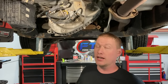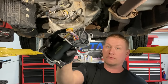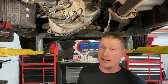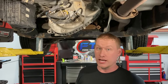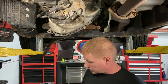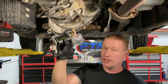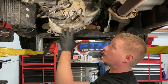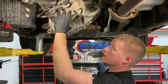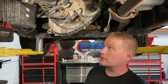It's a very common failure, but luckily it's a very quick fix. The only problem is the Ford motor, which is the one I recommend, is expensive — about $250 — but hopefully it's the last time you need to change it for the life of the truck. Today we're going to go over the procedure to change this out. There is a specific way to do it, but it's pretty easy. It's right on the back of the transfer case, nothing's really in the way besides maybe the skid plate on certain vehicles.